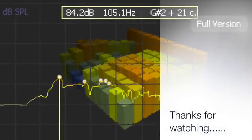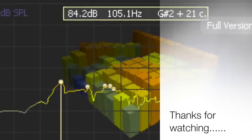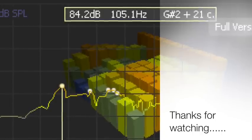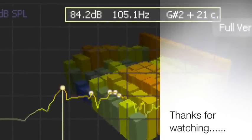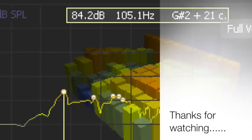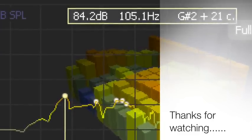As you can see from this diagram, from the vertical line and the dialog box at the top, we've measured the belt tension at 105 hertz, which is perfect for a Ducati. As I said earlier on, the measurement needs to be anywhere between 105 and 115. So this is absolutely spot on. Thanks for watching. See you soon.